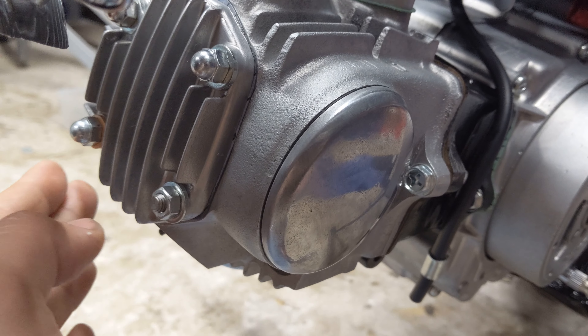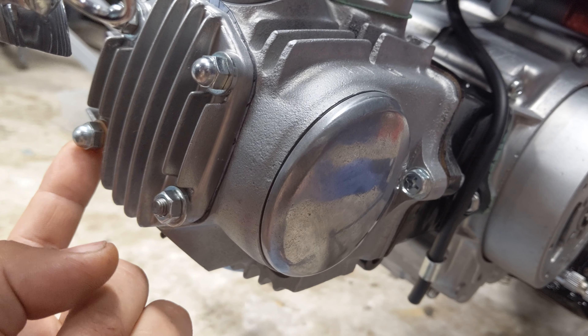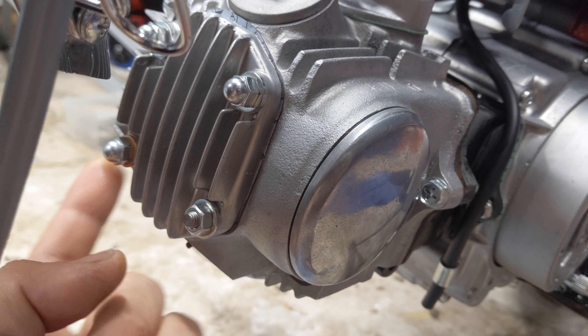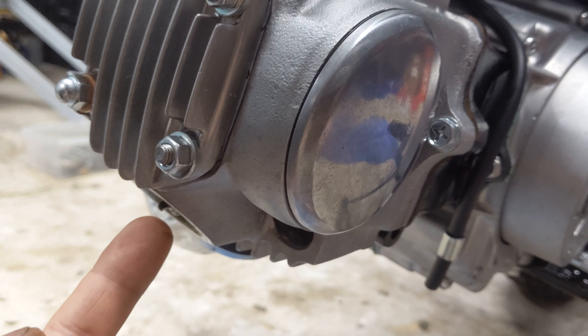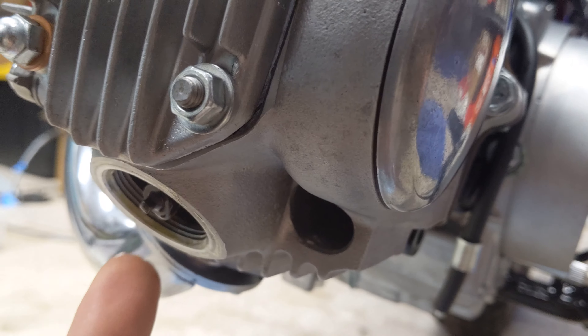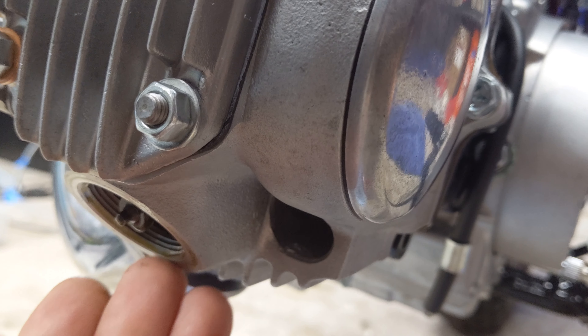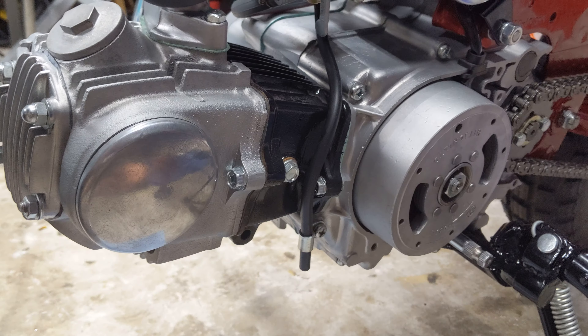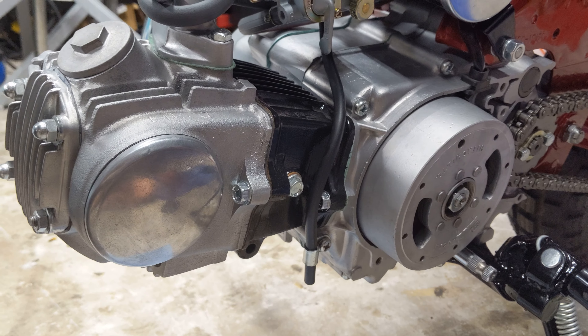The manuals say that if you want to test your oiling system, you undo the torquing of the acorn nut on the oil feed stud — but you don't need to do that. No reason to untorque your top end or that nut. You can simply remove your lower tappet cover and get visual access to the oiling system. Once it starts to develop pressure, you'll visually see the oil starting to come out of the tappet access area. This is a new engine, but I've primed it and ran it — it sat overnight — and we'll see how long it takes to build the pressure back up and provide oil to lubricate the top end.